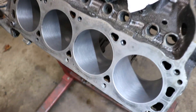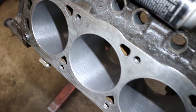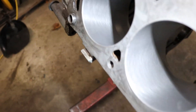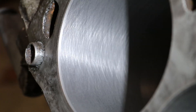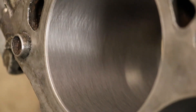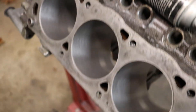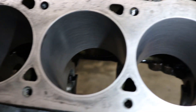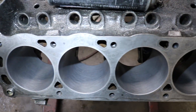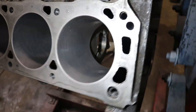Here's what it looks like after honing — you can see that cross-hatching in there. There's still a little bit more to clean up on this side. I was going to try to show a ring ridge but this motor is actually really good. With my eye you can kind of see a tiny line there on my finger, but if you have bad ring ridge you'd have a glaze spot. Overall this motor looks really good — it cleaned up most of the way.